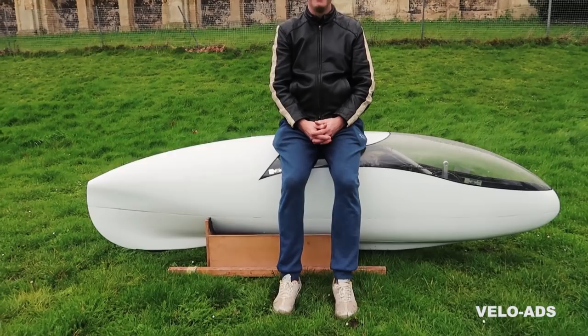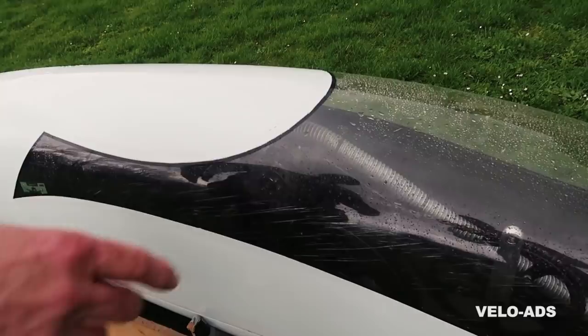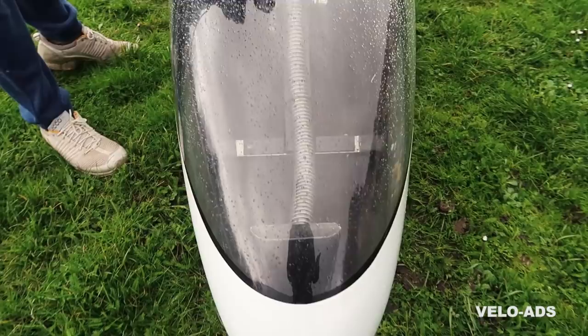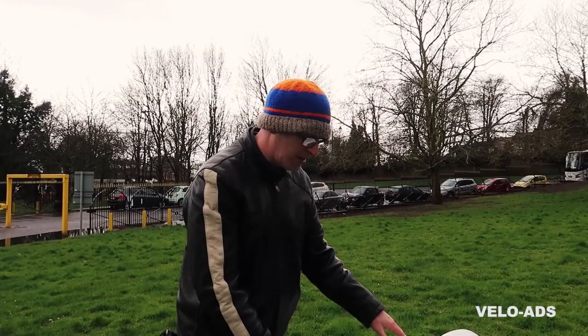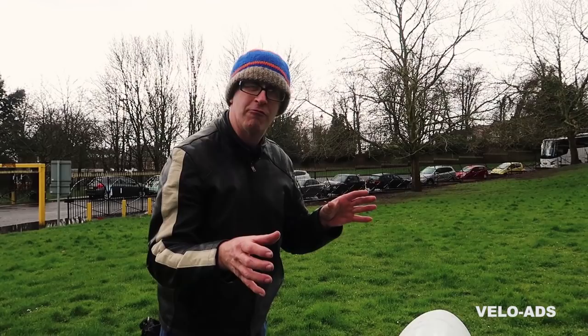Morning, John. Morning, Neil. Carbon fibre body with steel struts carbon fibred into the bodywork. It has a spine of metal right down the middle of the bike, but low down. There's no seat in it because I can't have a seat in it, so I literally lay in the body. It's front wheel drive. The whole mechanism is just four bolts, and you can lift the whole lot out. Literally in 10 minutes, I can lift all the running gear out completely.